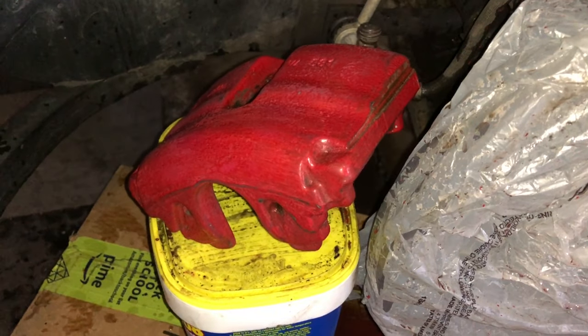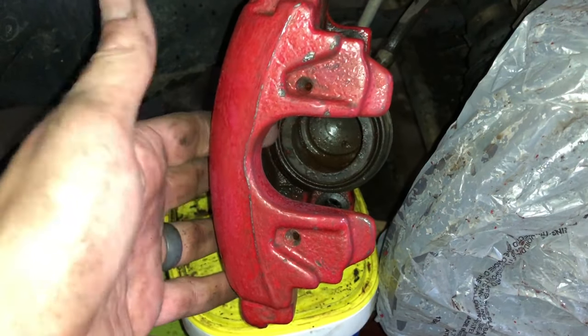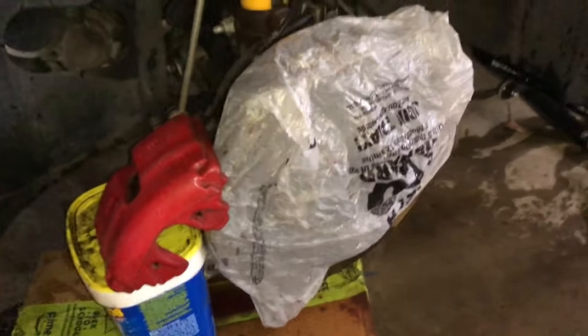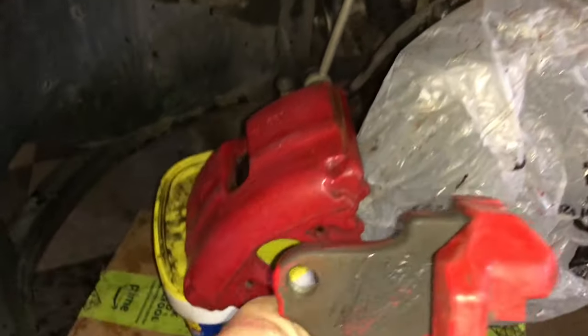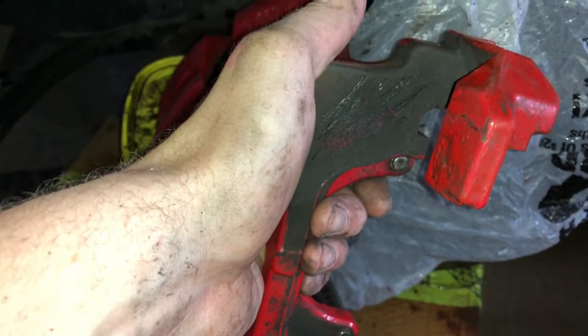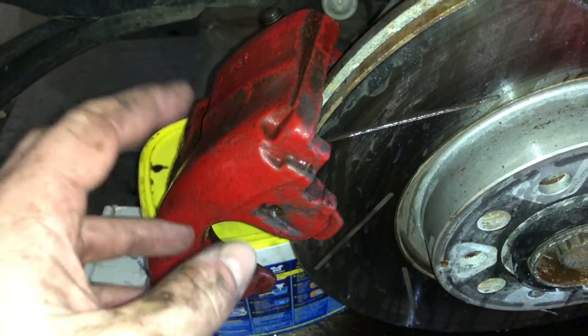This is about an hour of work on this caliper and as you can see it still looks like crap. I've used a combination of solvents, dissolvers, wet sanding, and tried to get all the debris off. Even worse is this part of the caliper — when you flip it around to the side you'll actually see, it looks terrible as well. So I think we move on to Plan B. I've used sandpaper, wire brush, solvent, and even paint thinner and they're still not where I'd like them to be. I'm not confident the paint would even stick, or that they'd look good. So I've reached out to my buddy Dan and we're going to head over to the media blaster.